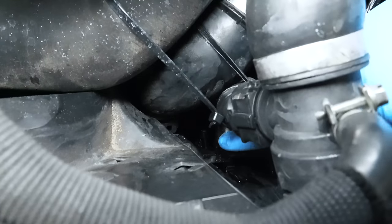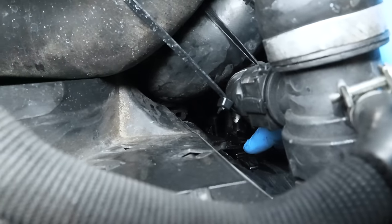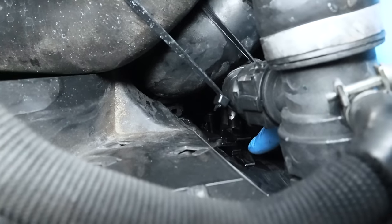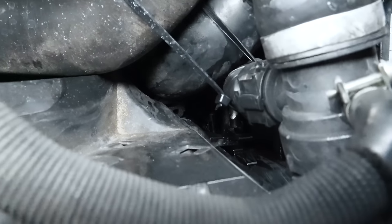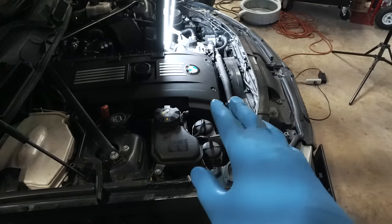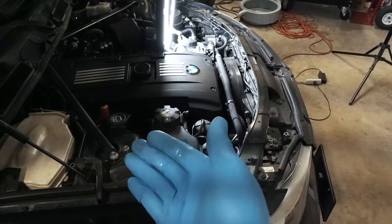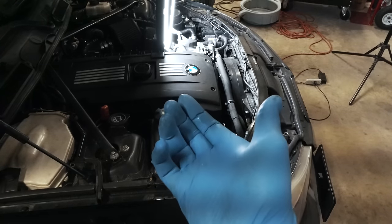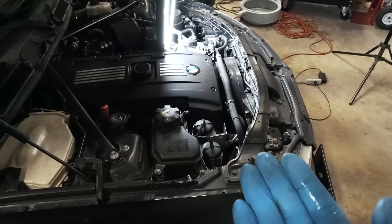If you pay attention right here, you'll see that the fan shroud actually clicks into the side of the radiator right here. So we're going to have to kind of pull this tab out of the way and lift up on the fan shroud. It's right below the upper rad hose. This car is automatic, so I won't be able to remove that fan shroud unless I go underneath the car, remove the splash shield, and undo one screw which holds the automatic transmission cooler to the fan shroud. So I'll get the car raised up now.